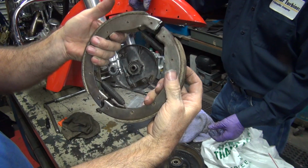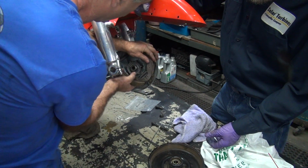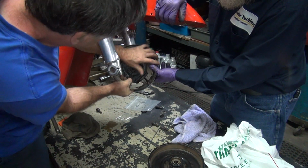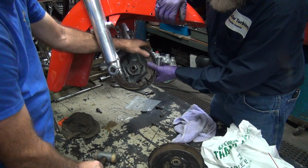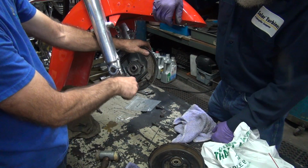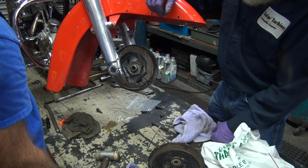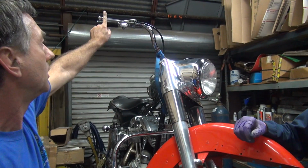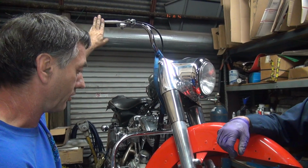These springs don't have a lot of tension to them, so I can hold them. They should be tight right now, they're not. Hold yours down. Screwdriver. Why it was so hard. I see. But see, that has tension like it should have on it. No, it doesn't. Not as much. Ooh, it almost removes it back all the way. See, the tension is so low, it won't bring the cable all the way back. See, the cable needs to go back to here. It won't do it. It won't overcome the drag because those are weak springs.